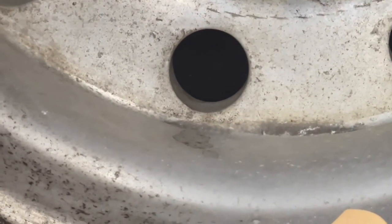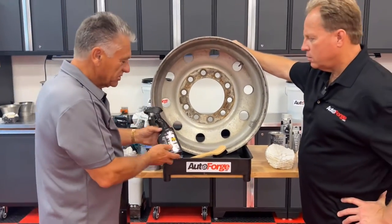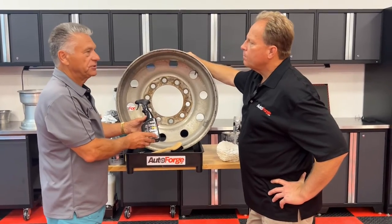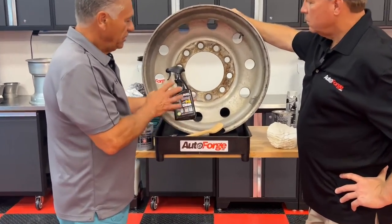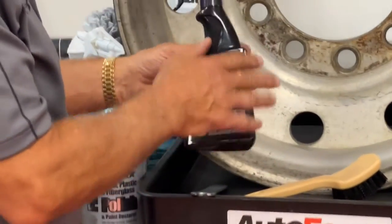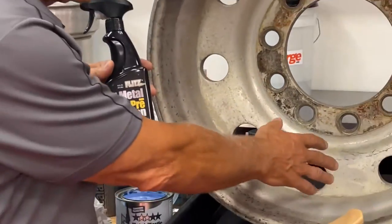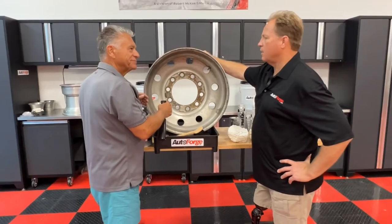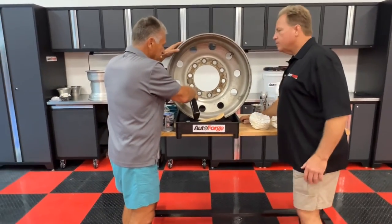So we're going to show you a quick way to not only remove it, but how to maintain it. What we're going to start with is a product called pre-clean. Now this is very similar to acid, but it's made of salt — it's not acid. High pH. It's probably what makes it unique — it will not make the aluminum white. I don't know if you ever used white acid on a trailer or a truck wheel — it stains it white instantly. And fixing that takes a long time and a lot of work. That's why even truck stops and truck washes don't like to use it.